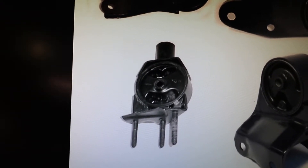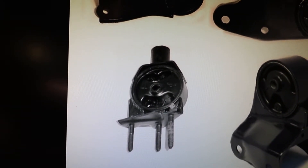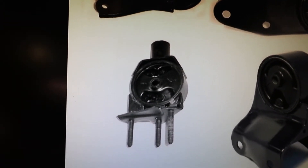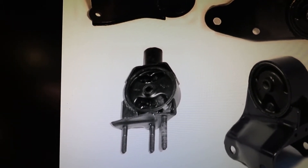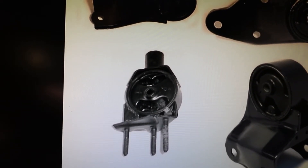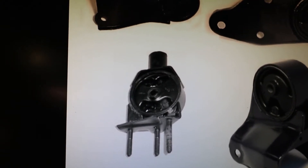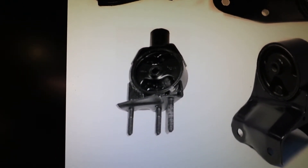This one is the rear driver's motor mount. This requires some explanation because those welded-on bolts sticking out go into a flange that has nuts fit on, and it tightens to a flange. When you remove it, the aluminum flange bracket underneath has four bolts that bolt to the engine. To take it out and put it in, you have to loosen and remove all the nuts and bolts, including the top center one that goes through the rubber.